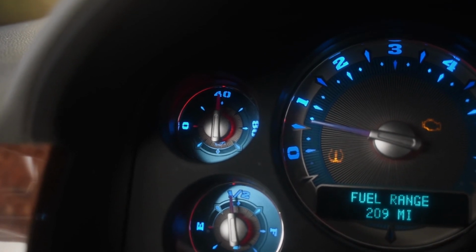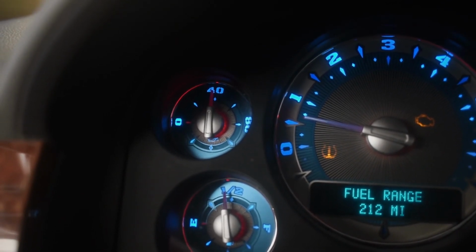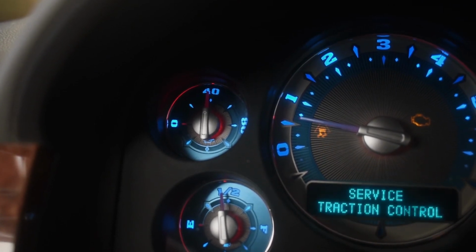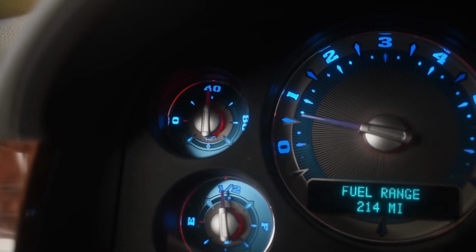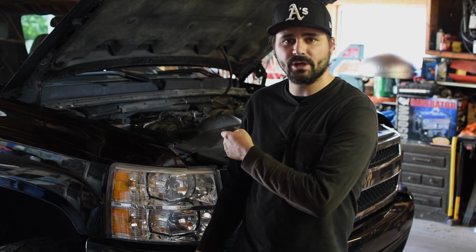Still got that check engine code though. Let me see. I can reset it and it'll come back on. P0523. Yeah, it still has it. Most likely just because it read it right when it started up before it registered. Try clearing it out though. There we go. Cleared it out. Okay, and there it is, it's fixed. We've got oil pressure now. Bingo. Okay, so there you go. The part's changed out. We have oil pressure reading on the gauge.